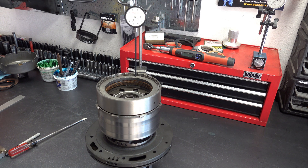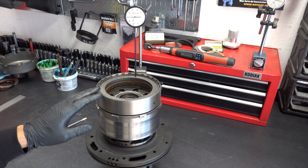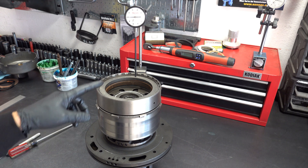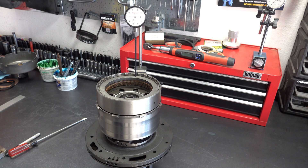Hey there, welcome again. In this video I'm going to show you how to adjust your clearance for your forward and your direct clutch packs on a Ford C6 transmission. Going together with this one, and unfortunately I'm a little too tight here on my clearance for the forward clutch. Direct clutch is fine but a little too tight on forward. For the forward clutch you want to be between 21 and 40 thousandths of an inch and I am just shy of that figure on the low side.